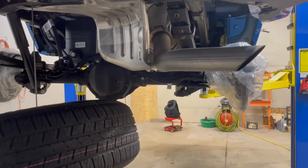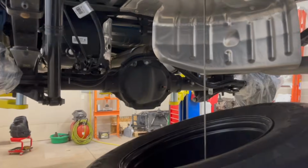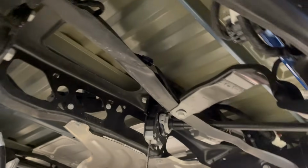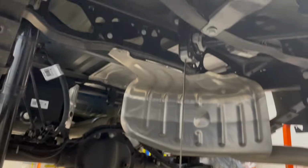This thing's just about getting ready to get sprayed. One of the big things on a vehicle that's never been fluid filmed or sprayed before, drop the spare tire, because there's a lot of surface area and a lot of intricacy behind that spare tire. And the spare tire does block a lot of garbage, so you don't have to do this every year if you don't want to. But it's a good idea to get that spare tire down.